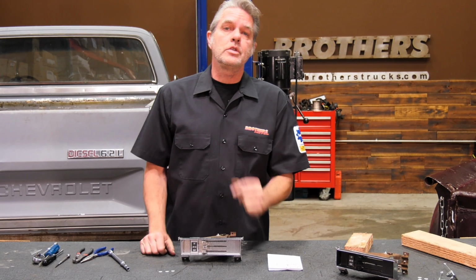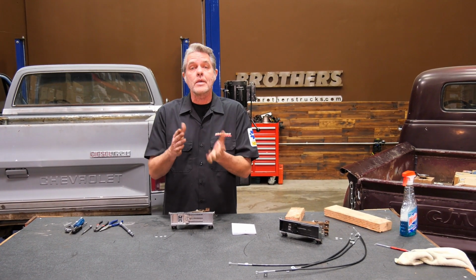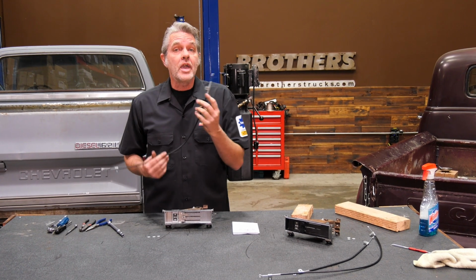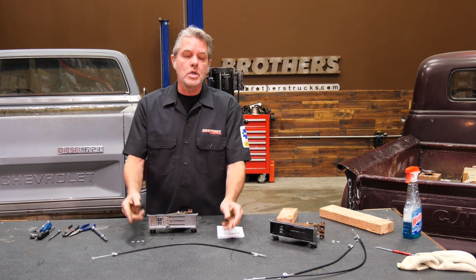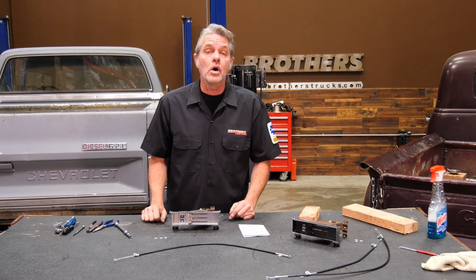Now let's say, for instance, that this is just too much, or the old one's just too beat up. It's not a big deal. We make them brand new. Why did the arms break in the first place? More than likely, your cables got all rusted up. They wouldn't move. You tried to do it anyway and they broke. So make sure you get your cables at the same time, and anything else on the dash that you want, to kill two birds with one stone.